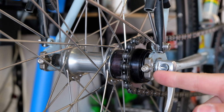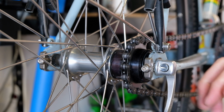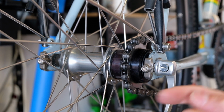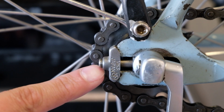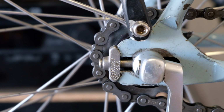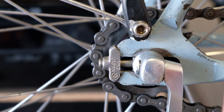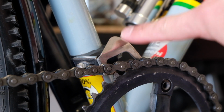Now, when I first got those, it was great. It lasted a little bit longer. But then, over time, these nuts would rattle out slowly. If you're going to get these, get some Loctite, put it in the threads, and that'll keep them from rattling out over time. So with this setup, with the adjusters and the Loctite in the threads, I have no issues with it rattling out. I have never adjusted it since I've had it.